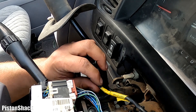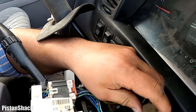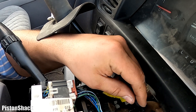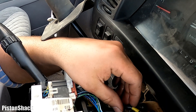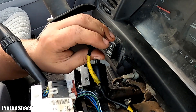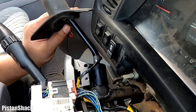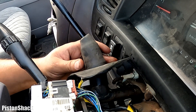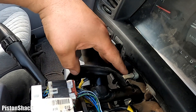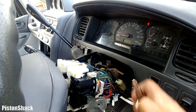Slide it down — the wire came out through the upper opening, nice and easy. Connect the electrical connector — click it all the way into place. Put it here and bend those holding clips back. Leave a little bit of slack in the wire, then pull the rubber boot down. That's it — put those covers back and you're good to go.